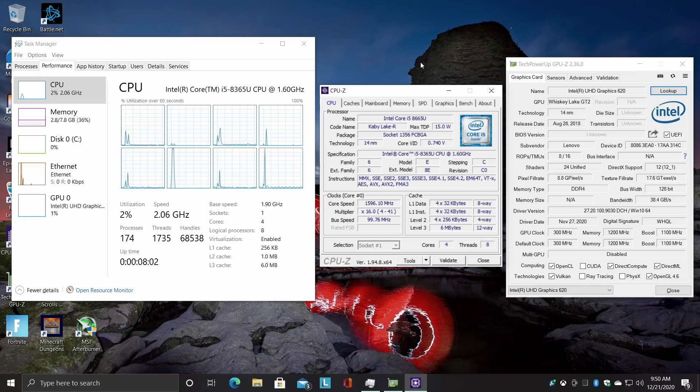I've got everything booted up with a lot of stuff installed to test. I did go into the BIOS to see if I could change this to a high performance setting, because usually Lenovo units like this have that option, but unfortunately this one doesn't. The only things I can really change are the C-states and the fan itself — silent, full blast, or a medium setting. While idling, doing 4K video, or web browsing, I can't hear the unit at all. If I start up a game it ramps up a bit, but it's not super loud. Under normal use you won't hear this unit.